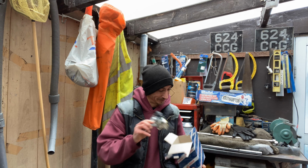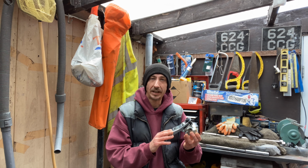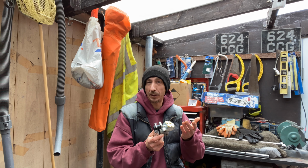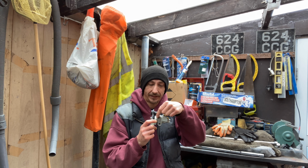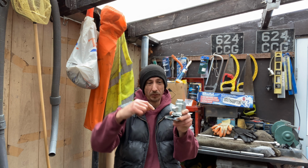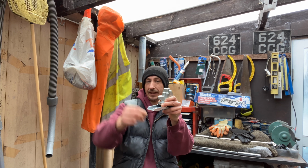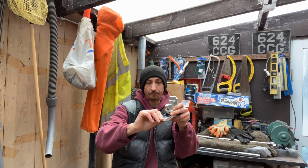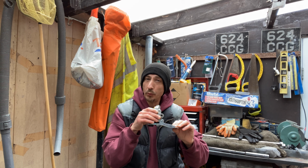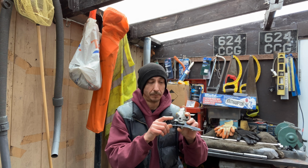Right, so what it is, this is a rear brake load compensator or a rear brake load bias valve. So in here is a little valve, so it will sit on the van like that. And along the back here will be a bar that's bolted, or sits on here, little plastic cap nut underneath. This can go up and down from this end here. It will go up and down depending on the load in your vehicle. So hence why this is a load brake bias valve.